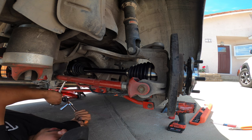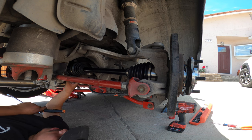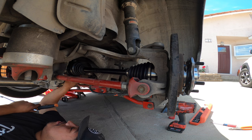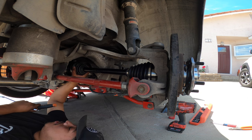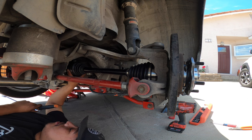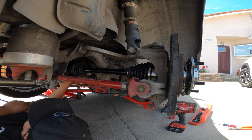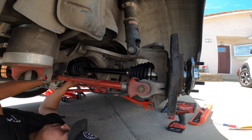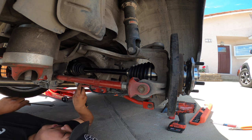Is it just me, or did you see play when you did that, like inside of the carrier? Yeah. Oh boy, you need to rebuild your diff bearings. Was that carrier bearings? I'm not sure, but yeah, you were right. God damn, dude, that's probably why your thing is leaking. Is there radial play, like side to side? In and out is probably fine, but side to side, like radial. Like you're pulling it in and out, and I'll push it sideways, or up and down. Yeah, you need a diff rebuild. Damn. The more you know, huh? I don't think those bearings are supposed to be like that.